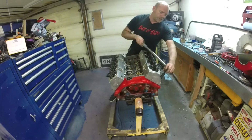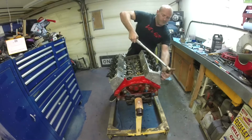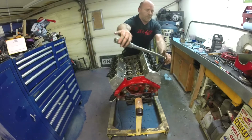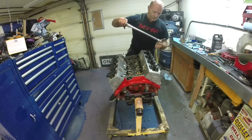So 50 foot-pounds, I'll do both heads, then 65, then 95.